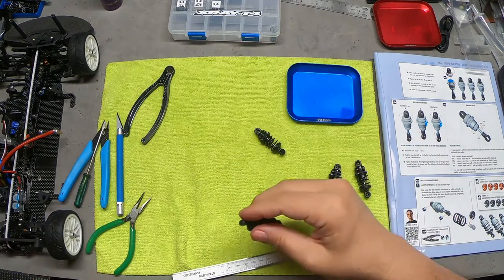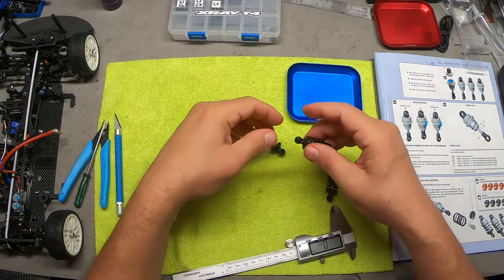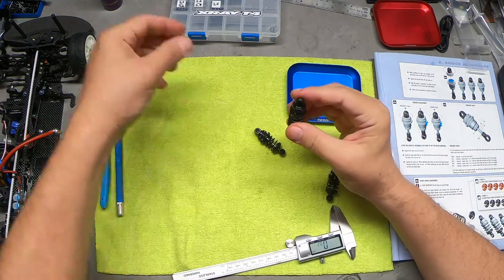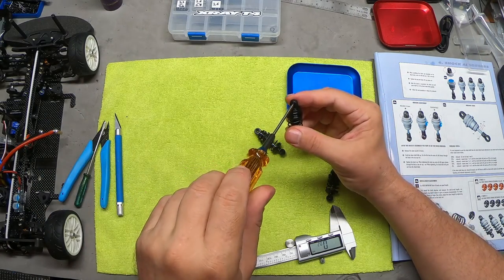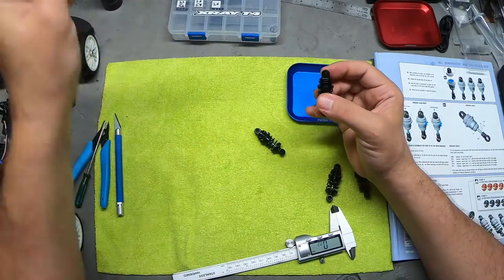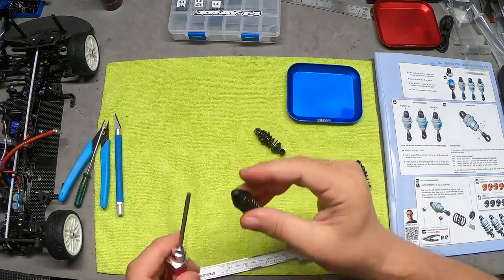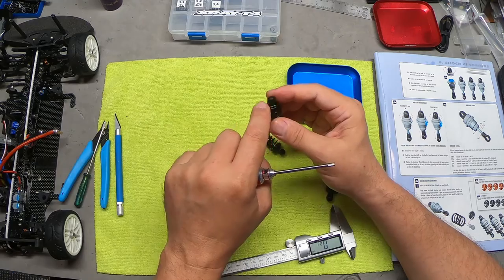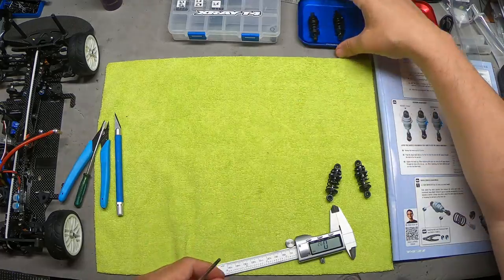This is a nice arrangement for these shock absorbers, the way they're set up. These ball studs are threaded. So we use our wrench. I think it's actually the next size up. Yep. There we go. And so these are threaded on one side, and that allows us to screw these onto a stud, so we don't need a separate bolt or a washer out here or anything like that. So rears, I'll set those aside,